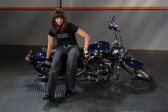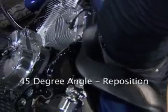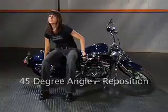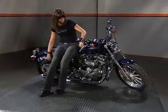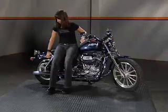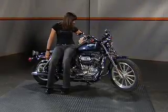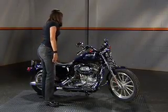The first 45 degrees of the lift are the biggest accomplishment. At the halfway point, slide your butt down to the middle of the seat and reposition your feet so they are closer to the motorcycle and closer together. Walk backwards toward the motorcycle with baby steps, continuing to push your butt back into the seat. Keep going until you walk the motorcycle back to an upright position. Finish the job by pushing the bike just past 90 degrees, resting it down on its side stand.